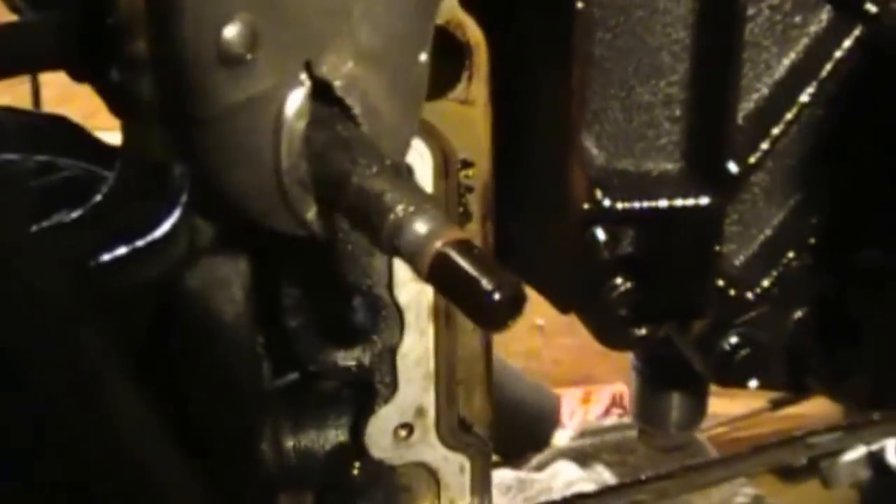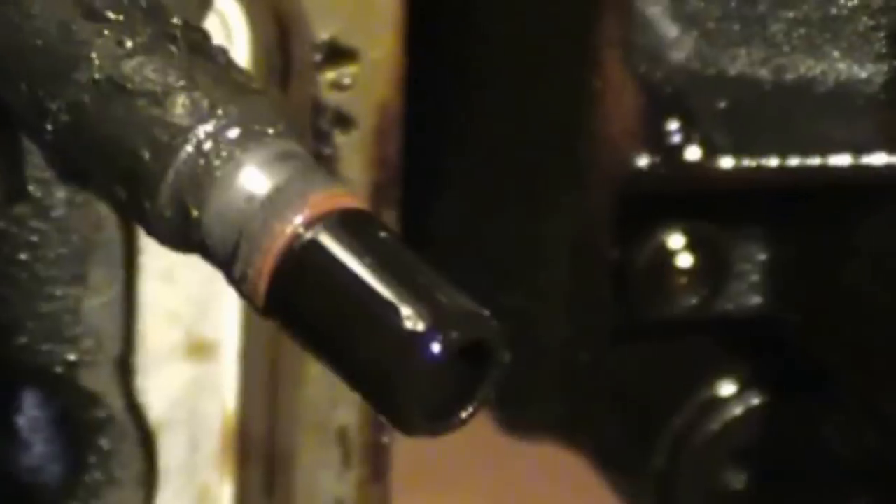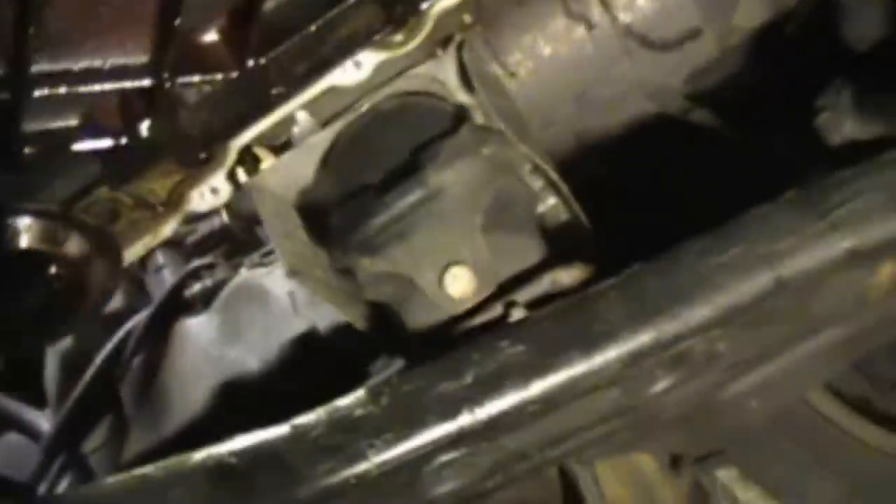There's a tube that runs up to the bottom of the oil pump on the front of the engine. The oil pan gasket is still on the block - this is actually a reusable gasket. The way I got the dipstick out of the oil pan was with a pair of vice grips on the dipstick and just tapped it with a hammer and it popped right out. There's a little tiny O-ring there - don't tear that because it might cause a leak. The oil pan bolts - there are a couple small ones in the back that are 10mm and the rest coming around are 15mm. You're probably not going to have to go this far if you're just replacing the timing chains, but just in case you want to pull the oil pan, it's pretty straightforward.